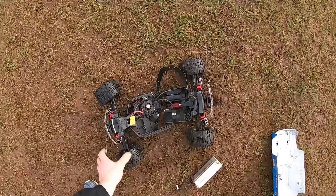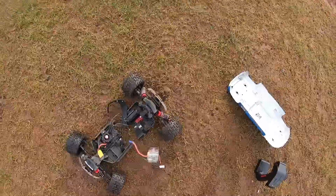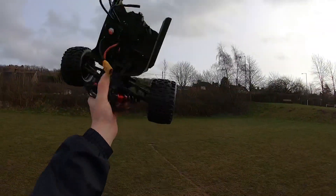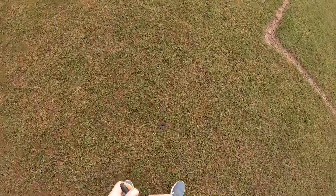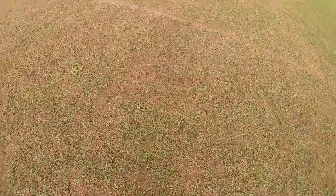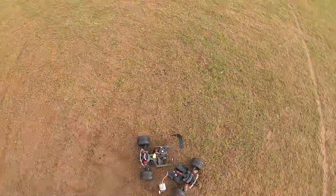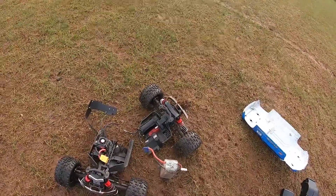It's been fun. Chassis has gone straight in the middle, so I don't have to buy any rear diff case housings or anything like that — just a brand new chassis and bash bar. Remember to like, comment, share, subscribe for more carnage! Lipo's alright. I forgot to mention the wheels as well — Fast Trax Jigsaw tyres, they really are amazing, they hold up amazingly. Drive shaft came out somewhere, we'll have a look for that. I've never snapped one clean in half like that before. It's just too heavy with the battery — I'm going to have to go back to the 4S. It's alright for speed runs, but I'll stick it on 4S, go up to a 20 tooth, and it should be at the sweet spot then. Thanks for watching, remember stay tuned for more carnage.